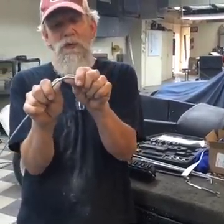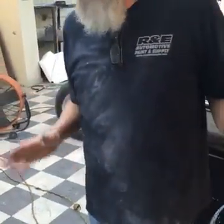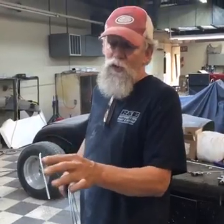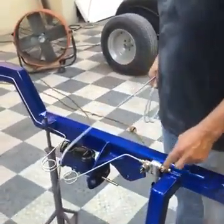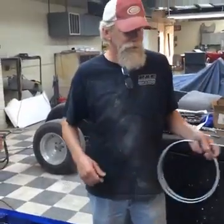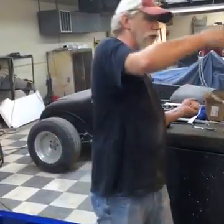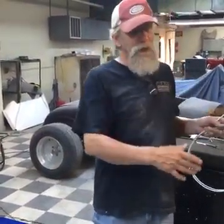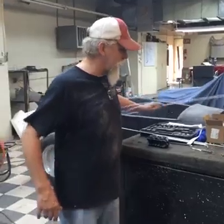I'm using a lot of very, very and multiple word things here, but there's certain things that can't happen. Brakes are very important. You want your car to stop. If you kink your line, there's a chance you're going to put a crack in it, and also you're going to restrict the flow, and the flow won't be going even, which is what this does. It restricts flow. So if you kink the line going this way, you're restricting flow on your right front brake. And what might happen is when you step on the brakes, that brake is not going to grab as fast as your left brake. So your car is going to want to turn to the right, or to the left, I mean. The same way if it's holding pressure on it, and your brakes aren't adjusted right, when you step on it, it might want to bring the car one way or another.